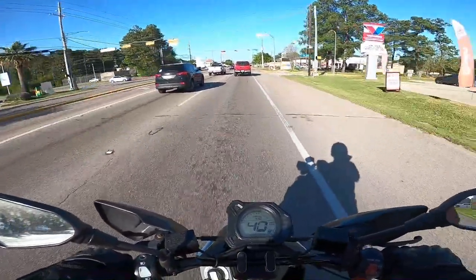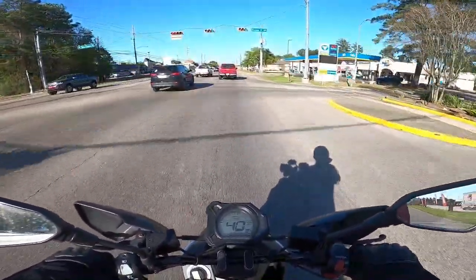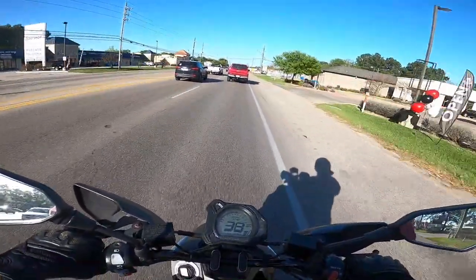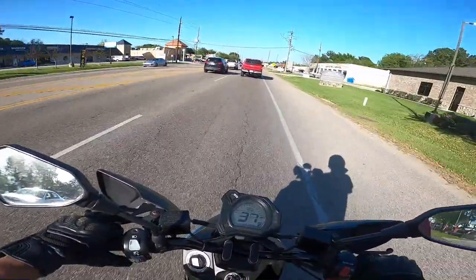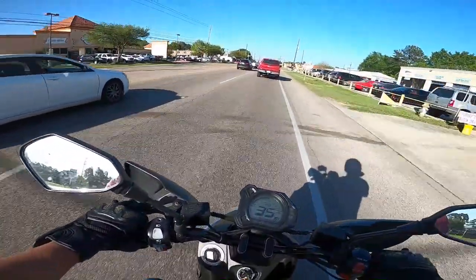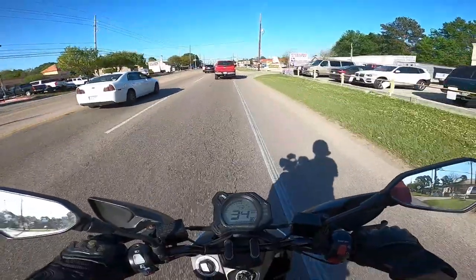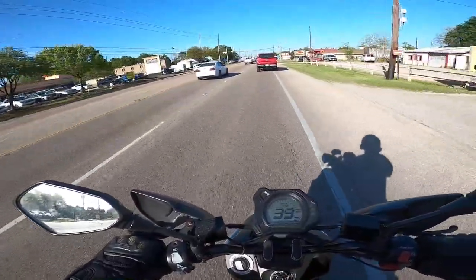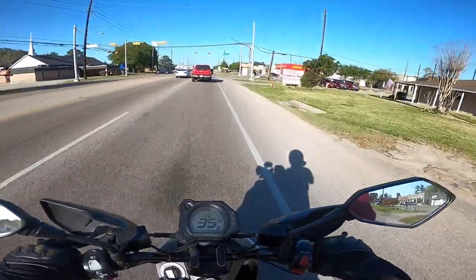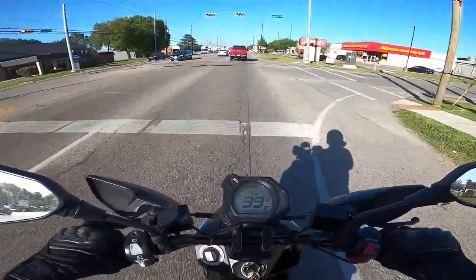And then, so I did the valve lash, set it, rolled the motor over, or turned the crank, checked it. And then after that, checked the exhaust side. The exhaust side was good. So it was the intake side that I had messed up somehow. So now I'm riding on a redo of the valves on the bike.